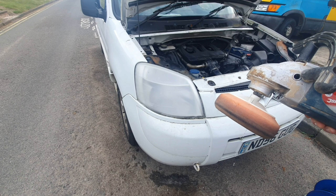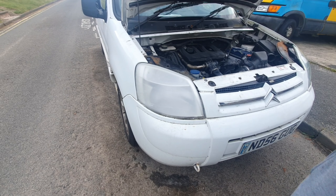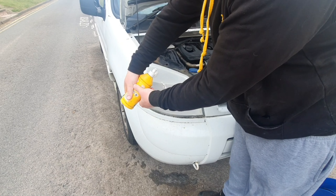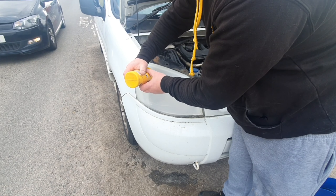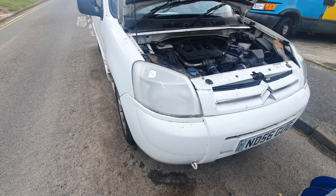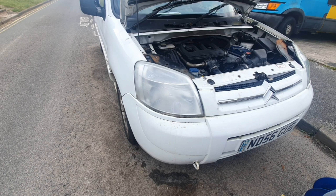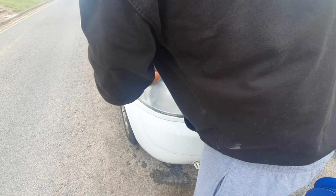Now I'm going to use this buffer and the G3 compound. I'm going to wet the buffing head and apply G3 to the headlight. I've put a bit too much on actually. I had to do a voiceover on this because I live on top of a hill — the wind was really strong and there was passing traffic. I wet the buffing head to make sure it's nicely lubricated, because if you don't you'll end up burning the plastic and getting burn marks in it, and that's not what you want. Get a bit more lubrication, spread the G3 compound.